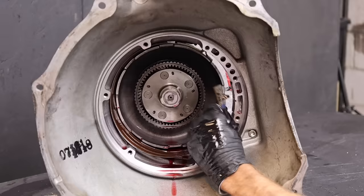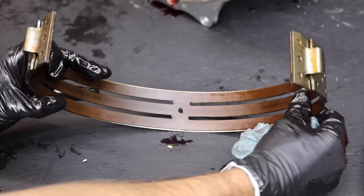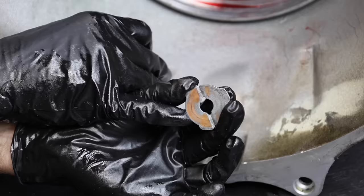Now is a good time to remove the second gear band. Since I bought the 1996 Ram 16 years ago, I've adjusted the transmission band a couple of times to ensure proper tension. The original second gear band is on the table and the replacement is on top — the new band has a lot more surface area and is designed for more durability. Let's remove the Mickey Mouse washer and the steel spacer; there's quite a bit of wear and the copper is coming through.